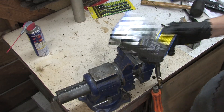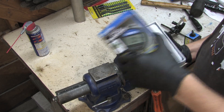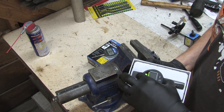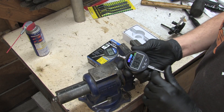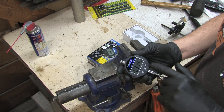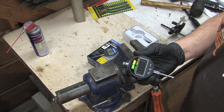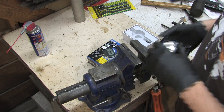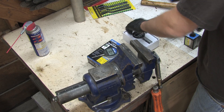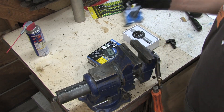There are a couple of ways to do this. This is called a digital indicator — it's similar to the dial gauge in the previous video, but it's digital and it only measures to a half thousandth. You use these to measure runout, end play, step height, etc. The plunger of the dial gauge is spring loaded to ensure it always makes contact. The idea is to get the indicator set up so that the plunger moves parallel with whatever you're measuring, and from a fraction of an inch into its range. These things aren't accurate if you zero them at the end of their reach.